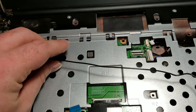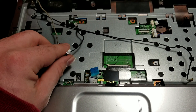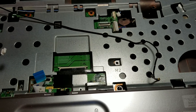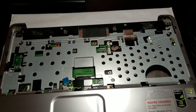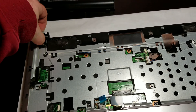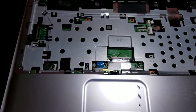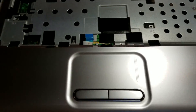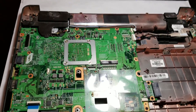Now with everything done, you undo your Wi-Fi wires, undo your display cable, and undo the other cables as well. The screen should lift right out of its spot. With the screen removed, we can now take away the entire shell. Be sure that you unplug the trackpad ribbon cable as well. Make sure you've removed all the screws — there is a screw right here in this corner. Once all screws are removed, you can start right here in a corner and it should lift up and away.